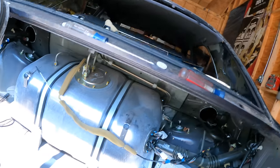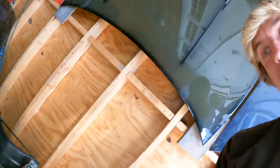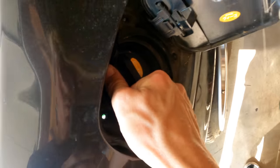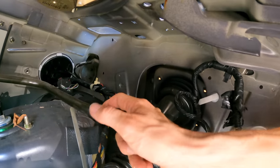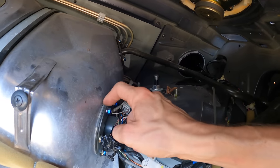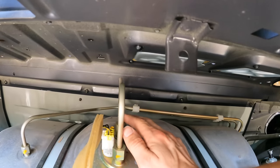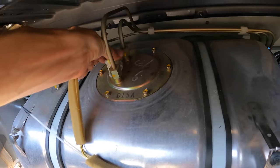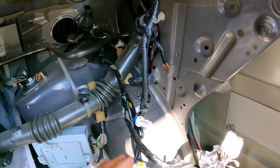We're going to have to take out the fuel tank, so I might as well take off the fuel filler neck. You can see all these stickers in here — there's a bunch of them, must mean something from Japan. Once we disconnect the bolts holding in the tank, we'll be able to slide it out. Looks like a tube also attaches there. I'm going to leave it as one piece. We have the fuel feed, return, and vent over here — that looks like the only disconnect spot. Might as well unplug it now.